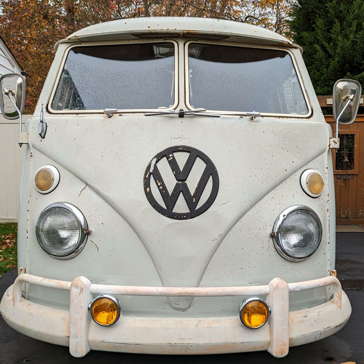A few days later, I feel that my elbow is in good enough shape for some light work, and I pull out the stitches and bandage everything up real quick so as not to get any dirt in the wound, and I start to disassemble the front brakes completely. It's a pretty clean and easy job, because I just cleaned and rebuilt these front drums a few months ago. The new front disc conversion kit arrives, and it has everything: new rotors, calipers, mounting brackets, the master cylinder, the inner and outer wheel bearings and races, brake hoses and bolts.